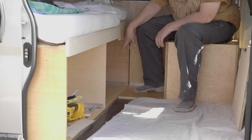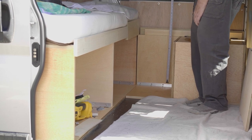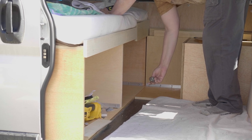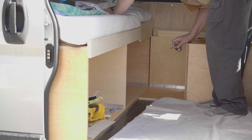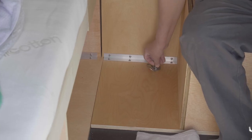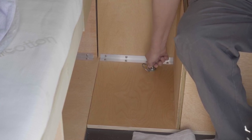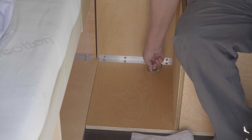Now I'll get my wife to take a video of the D-ring shackles, the one that I was talking about that's partly holding the toilet module in, as you can see right here where my tape measure is pointing, that's the other D-ring hole. And once I'm ready to put it in, we've got some longer 70mm M8 bolts, and you can get them from Home Depot in the automotive drawers, and that'll just screw in like that. And using the original heavy duty washer and the M8 bolt, as well as the D-ring shackle, that creates plenty of surface to hold down this plywood. It will not go anywhere. So that's basically what we're doing.